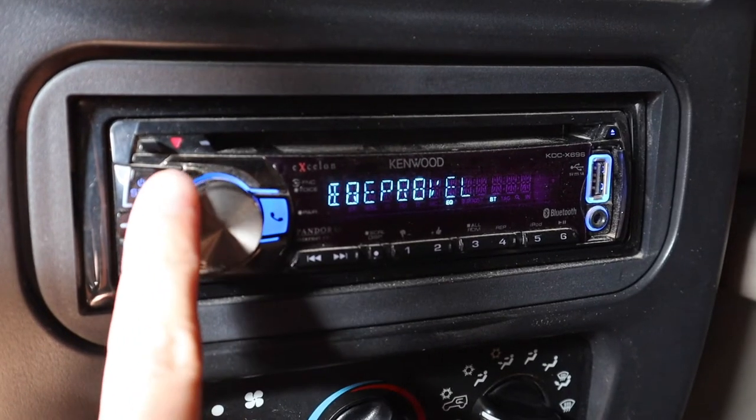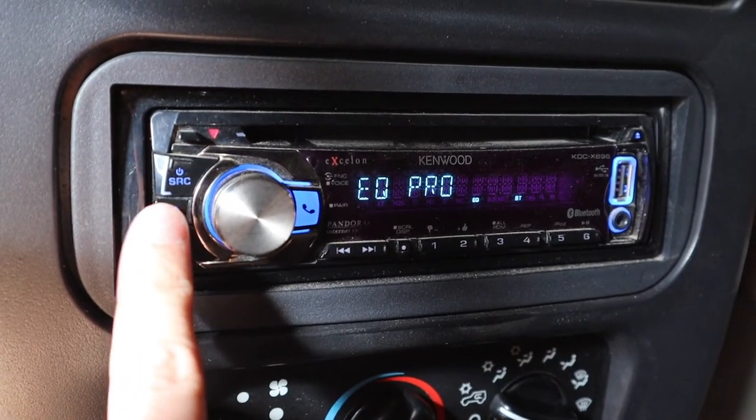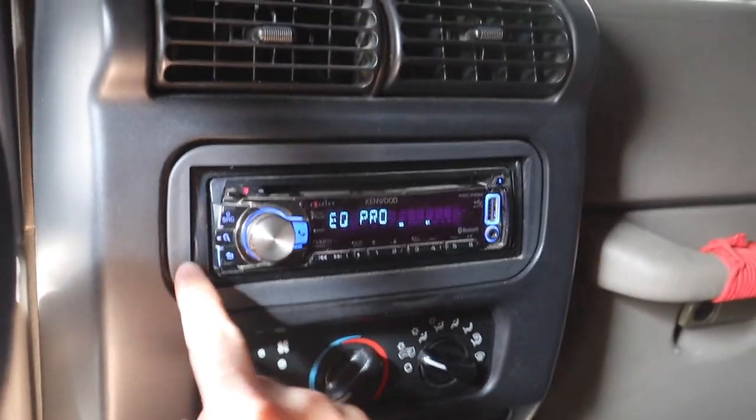There are also a few cheap ways to make your speakers sound better with products I'll leave in the description. The first is polyfill — a stuffed animal-like filling material you can put behind your speakers in the speaker box. It reduces rattling and scientifically makes the enclosure seem bigger than it is for the sound waves, making your speakers sound a little cleaner. The second is sound deadening — that sticky mat material that keeps sound in and blocks outside noise from coming in.